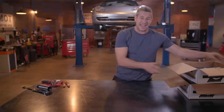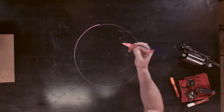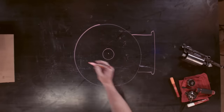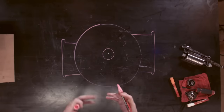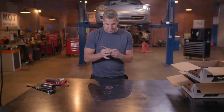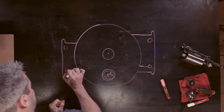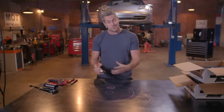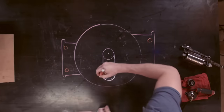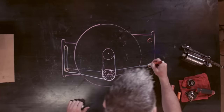If you imagine the simple layout of a basic boxer engine, it consists of a crankcase with the crank in the middle. Our engine is a twin head engine — a head on the right hand side and one on the left. Porsche have been fitting a secondary shaft, the intermediate shaft, the IMS, somewhere in there. Our engine is a four cam engine — two cams per head — and those cams are driven by a chain, but the chain doesn't come off the crankshaft, it comes off the IMS. So a chain driven by the crank turns the IMS, the second chain turns the first camshaft, the third chain turns the second camshaft, and of course that happens on the other side as well.